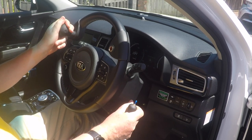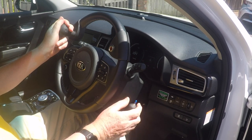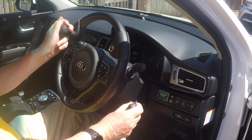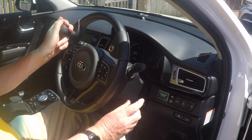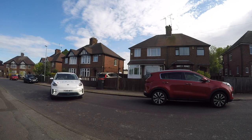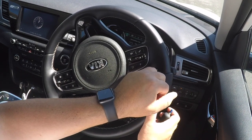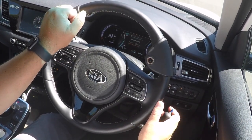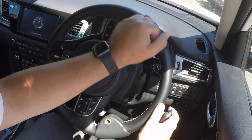If you're using a steering ball it's difficult to get to the indicator stalk, and it would be impossible when turning around a roundabout. So using an indicator switch mounted on the top of the hand control allows you to indicate left or right with ease whilst turning the steering wheel. It is a manual indicator which does not self-cancel, so you need to bring it across to the middle to cancel after use. Using push-pull hand controls and steering with the left hand you can easily make a 360-degree turn on the steering wheel and straighten up after.